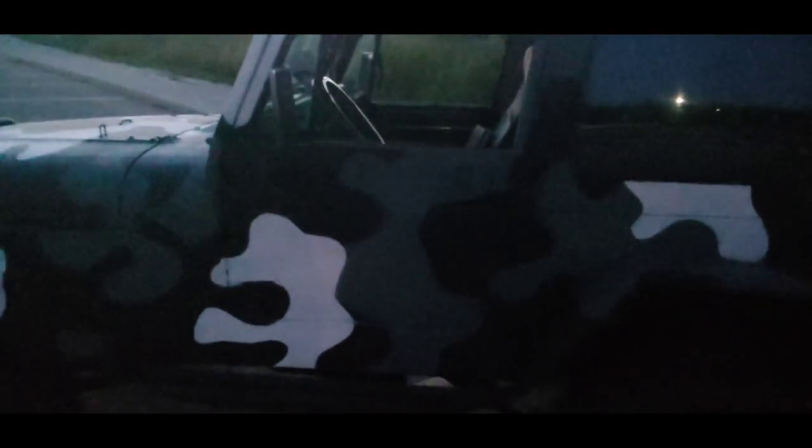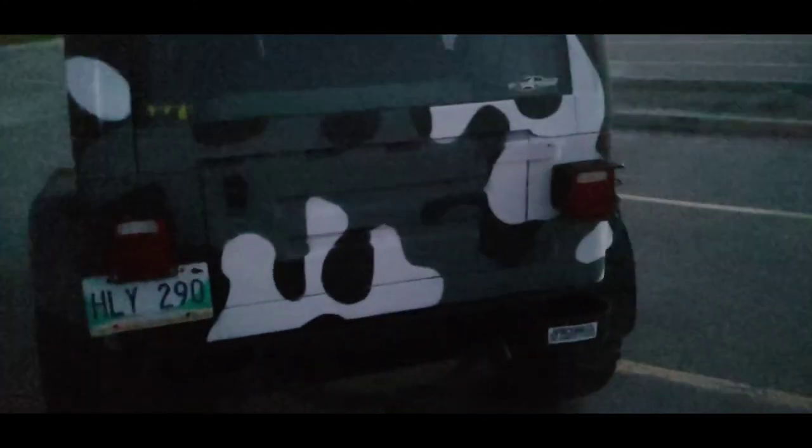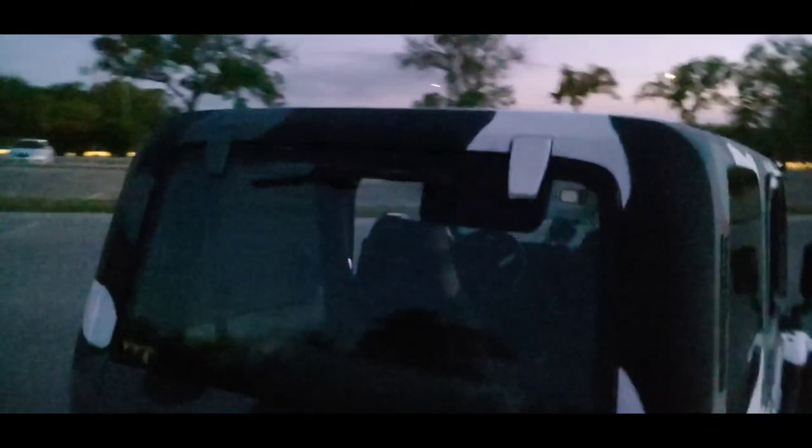Oh, well. That's going to wrap it up, though. Things that I learned when you're doing the pattern, start with bigger color blotches. These are even too small. You need to start with bigger solid patterns of gray and white and then cover over them with the smaller pieces. You'll go through a hell of a lot less touch-ups and work. What else did I learn? Learned that fine steel wool substitute stuff, basically like a Scotch-Brite pad, the fine stuff, when you use that with water as a wet sand, it takes care of lots of the overspray, makes the edges a little bit crisper again, but then you do have to clear coat over it.